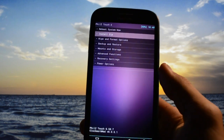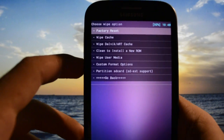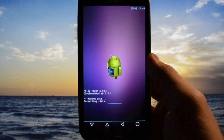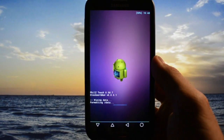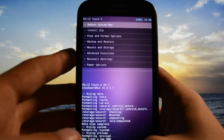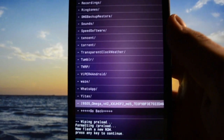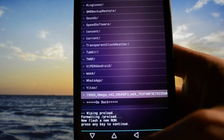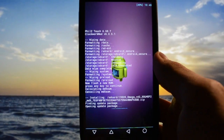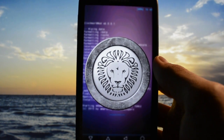After you've done your backup and all the things I mentioned before, all you need to do is go to the wipe and format options, and clean install the new ROM. Right now it is wiping. After you wipe your device, you're ready to flash the latest version of Omega — Omega version 42, OF2 base install — and we'll get into the AROMA installer.